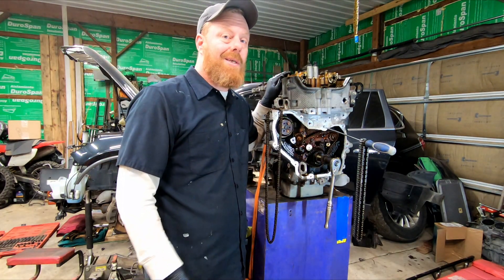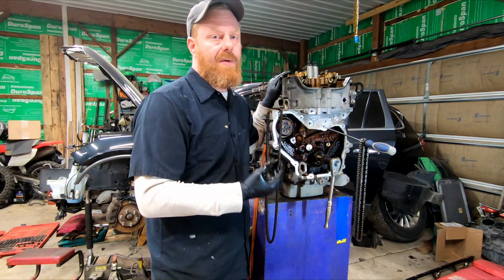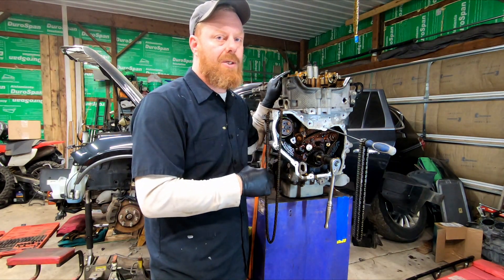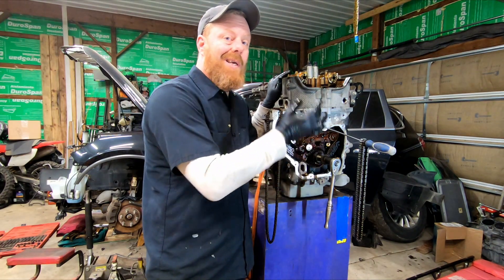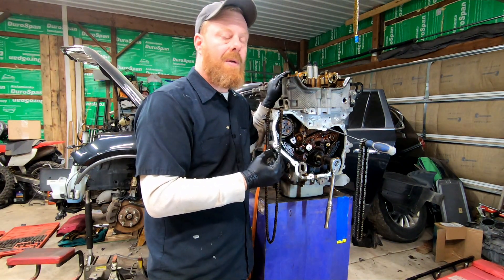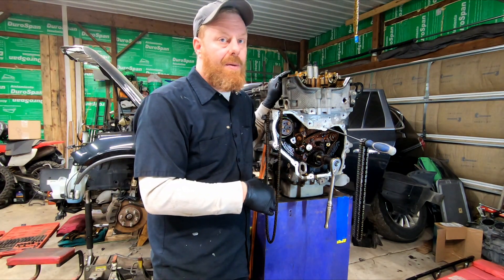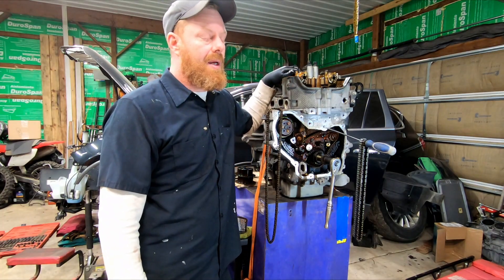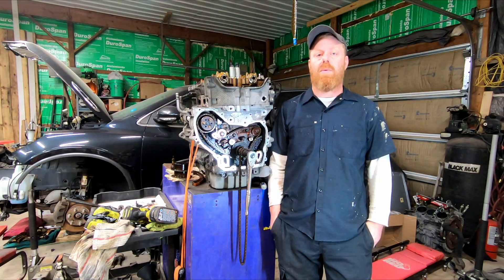So the only good way to avoid this issue is to just have it done. If you start to notice that rattle on cold startup, or you've got a check engine light and somebody scans it and says it's crankshaft and camshaft correlation and tells you your timing chain is probably going bad — it's better to address it. I know it's expensive, but it's usually never a cheap service. Thank you for watching.